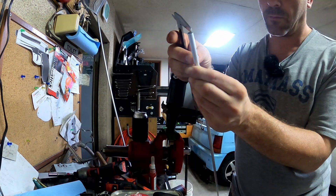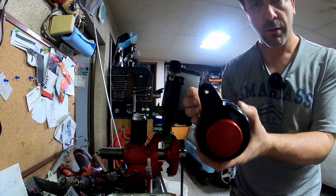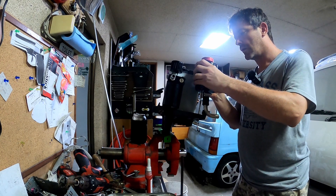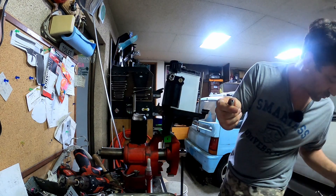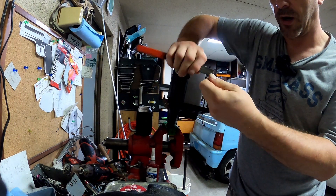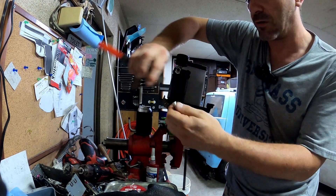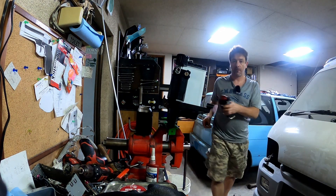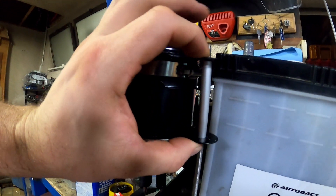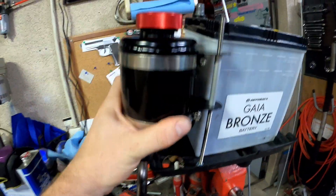So 59. I've got a mark here — I'm going to use my pipe cutter. It actually doesn't go on there because the end's all messed up. Let's run a screwdriver through it, or a file. If you're thinking you don't have a pipe cutter, you could do this with a hacksaw or a Dremel, no problem. The pipe cutter makes it perfectly straight, but I don't think it would even matter if you used a washer. Wedge that bad boy in there and then whack it on here. Now if I clamp the top and the bottom, it'll stay there.